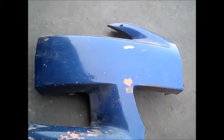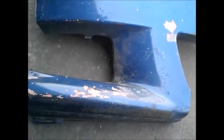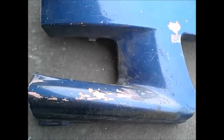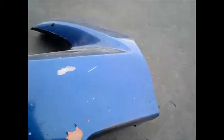Now, this one is one that we saved the quarter panel on, and we also replaced the front bumper. When you first look at it, you can see the Bondo filler that they skim-coated everywhere. The Bondo filler is a sponge, so it absorbs moisture, and the paint eventually is going to peel and have no durability. That's where they're getting all these rock chips.